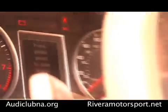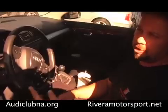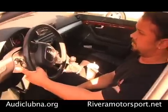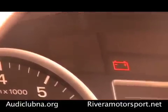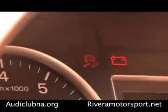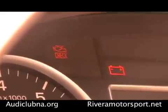Now I can hold the set button down and select the program. When I hold it down, it's going to flash once a second, then two times, and so forth up to four times a second — representing each program. The first program is stock mode, then 91, then 93, then 100 octane. So if I let go when it's flashing once, it goes into stock mode; if I let go when it's flashing two times, it goes into 91 mode, and so forth. I'm going to hold down the set button and push the check engine light button. It's flashing once a second — now I'll wait for two times a second. I'll let go now while it's flashing two times a second, and it's going to go into the second program: 91 octane mode. Then I turn the car off and turn it back on. I have to wait until the lights stop flashing before I can start the car, otherwise it will not start. Now they've stopped flashing, so the car will start.